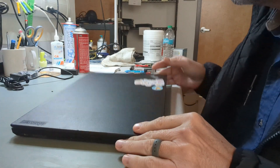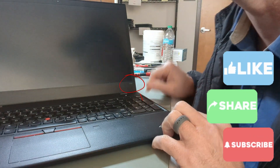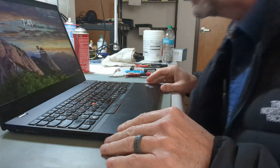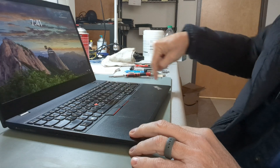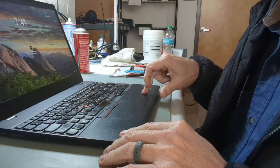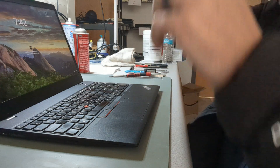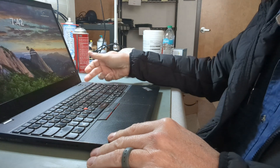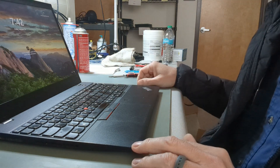Hello and welcome back to Randy's DIY. Today we have a Lenovo ThinkPad T580. On this particular unit I have two batteries — one which is removable from the outside and another one right under the top cover. When we log into this unit it gives us an error message about one of the batteries not being detected. I removed the external battery and still have the error, so I know it's the internal battery that has the problem.